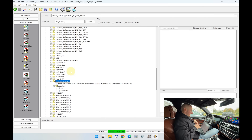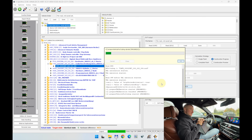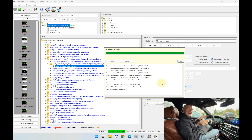MSA Memory is currently off. Right-click, Edit, and make it On — on that car it will work because we have the button. Press Save, go back, and before pressing Code you have to switch to diagnostics mode exactly as on the previous car: one, two, three — and press Code NCD. One more note: I'm often asked whether chip tuning stays after coding the engine ECU. The answer is no — chip tuning is not affected at all. That car has Stage 1 chip tuning and coding is absolutely safe because those parameters are stored in a separate part of the memory.